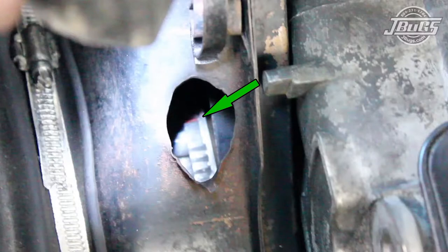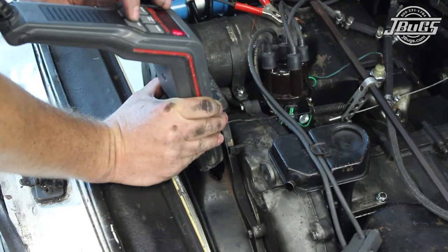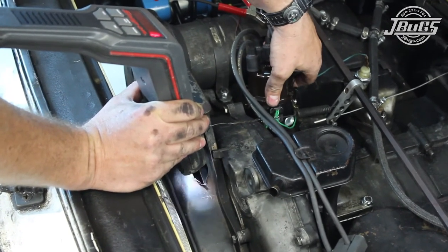The large mark at the left is top dead center, or TDC. The smaller marks to the right are different throughout the years but are typically marked at 7.5, 10, and 12.5 degrees. I use a timing light with a digital advance so I can retard or advance the timing to check from top dead center and be certain of our timing marks.